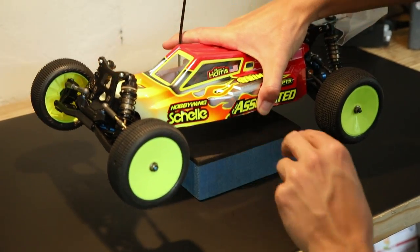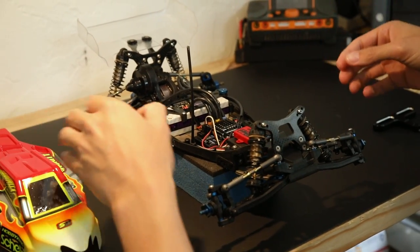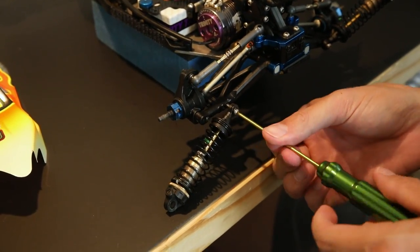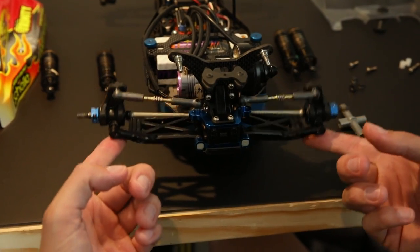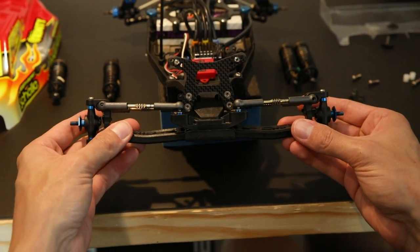The first thing we're going to do is work on the suspension. Go ahead and take all of the shock bodies off of the car. With the shock bodies removed, let's check that all of our suspension arms and the components surrounding them move freely. If they do, you're in good shape. Check for slop and extra wiggle and play, and replace the parts accordingly. Too much excessive play or slop in any of these components will create an undesired effect on the track — the car will just handle very inconsistently and it won't do what you want.